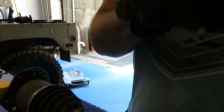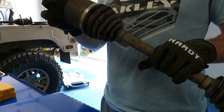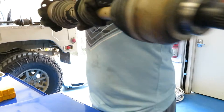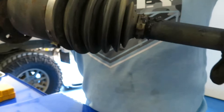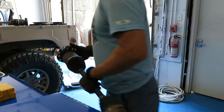This is the good half shaft that was on the driver's side. It can plunge in and out and everything turns when I turn it. I can plunge it in and out and it still turns. The bad one — I plunge it in and out and it doesn't turn. It's got 800 miles on it and it's already a bad half shaft. That's the noise you get — you're hitting the brakes and getting all kinds of noise from that half shaft, and the brakes were getting all chewed up.